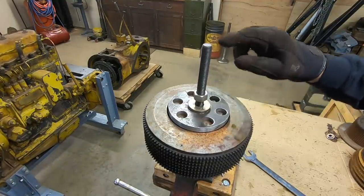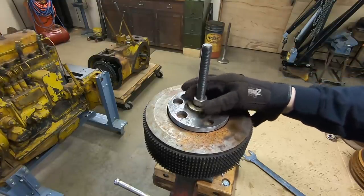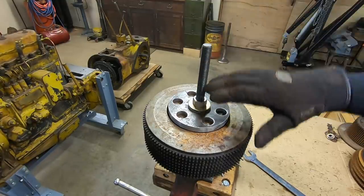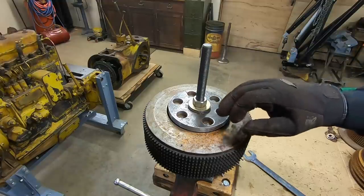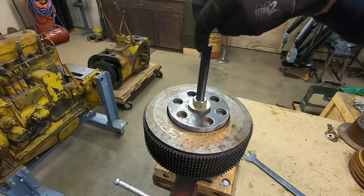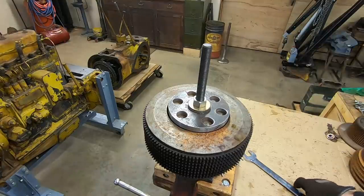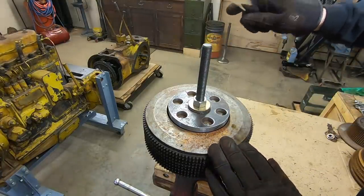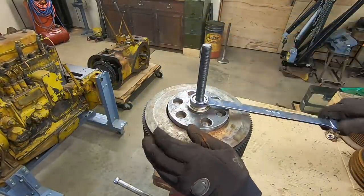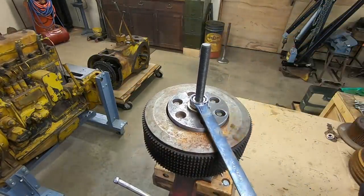It takes a while to run this nut all the way down to the compressor disc, but you definitely want enough threaded rod sticking up to back that off and completely release tension on all the springs before you run out of thread. You don't want the nut to come off with an unknown amount of pressure still on — pieces could fly. Stored energy. You have to be thinking about the danger aspect at all times. Even still, don't put your face or head right above this, because things can happen.